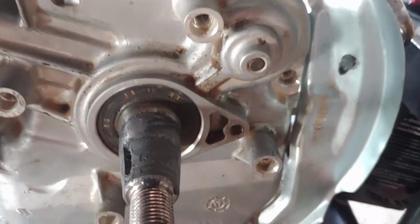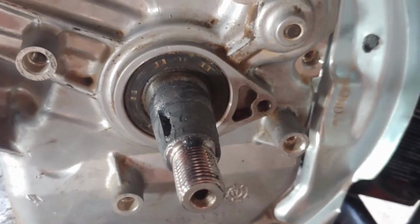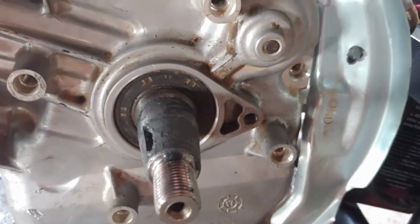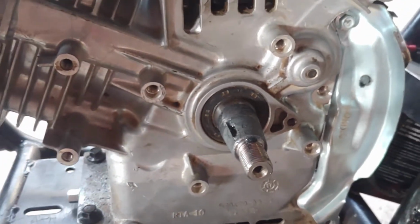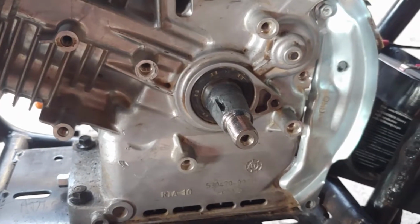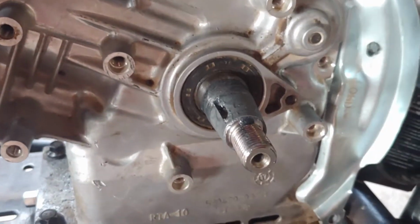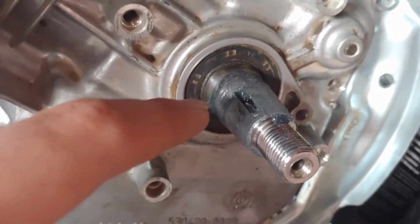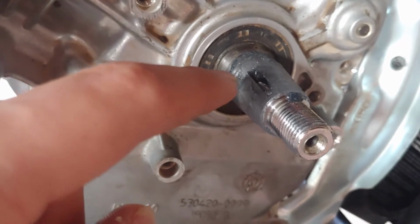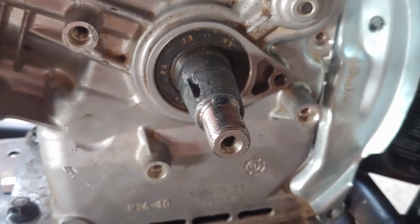Okay, so as you can see, the grinding material is on there. It's also on the inside of the flywheel as well, but I just put a nice fat glob of grinding material on there, and then lapped the flywheel on there a couple times. So now what I'm going to do is get some paper towels and make sure this is super clean, also the flywheel, and I'm going to get a little Q-tip and get the lapping material, the grinding compound, out of there as well, because you want it spotless of that stuff, because you do not want that on your flywheel.